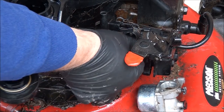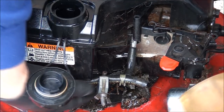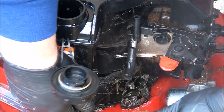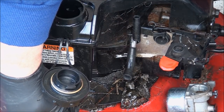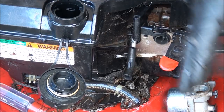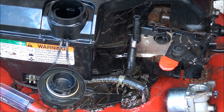You have your little gasket here that goes on the manifold — the manifold's not broken, everything's still tight. Let's finish draining this gas tank. It's about 45 degrees out here. Looks like we're back to winter — we had about a 25 minute spring. Now we're back to winter here in the Pacific Northwest. You got to like rain if you live out here. I'm going to continue to let this drain and completely dry out the fuel tank.